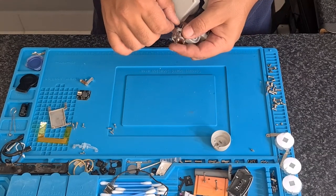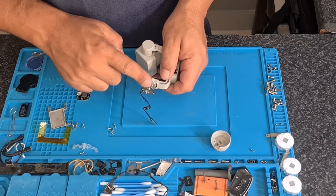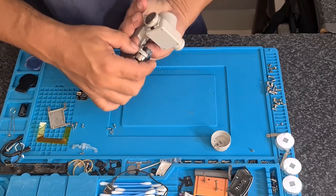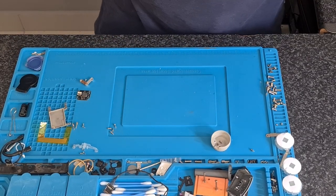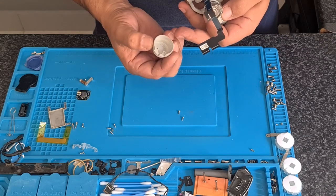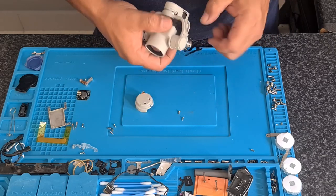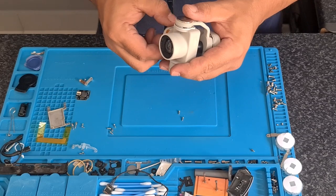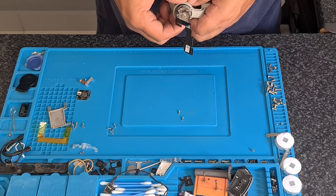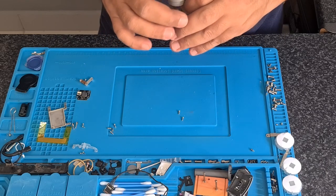Super smooth — no chafing. The tension feels perfect both ways, quite smooth. The cap looks okay. On Phantom 4 units the gimbal tends to chafe on this cap, so that's also something to test for. Here we need things to be straight — no chafing, no touching. That's a good sight.